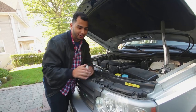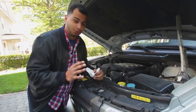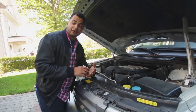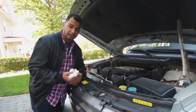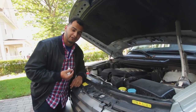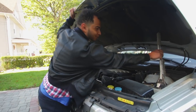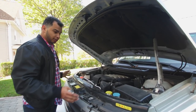The next thing you want to check is your windshield wiper reservoir, denoted by this blue cap — it's usually a blue cap on every car. This runs out really quickly but you can basically get it for a dollar a gallon. You also want to do a cursory visual inspection: make sure you don't have any leaking fluids or leaking oil around the valve covers — that's usually where it seeps. Also check for power steering line leaks, oil leaks, and transmission fluid leaks. You'll notice it if you look under the car and see puddles. The only normal one is a water drip from your AC evaporator — that's just part of its regular process. This engine actually looks very good, other than the fact that the hood struts don't work and I have to use an ice scraper to keep the hood up.